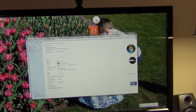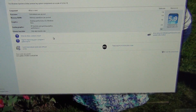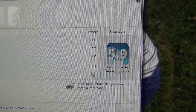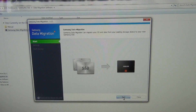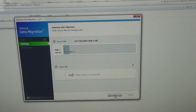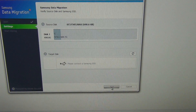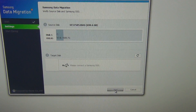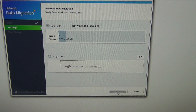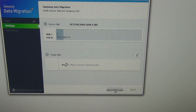The Windows Experience score is 5.9, but let's take a look at how much of that is the hard drive. As you can see: 7.4, 7.4, 7.8, 7.8, 5.9 — and that last one is the primary hard drive. One important thing to always check before you buy your SSD is to see how much space you're using. In this case there's actually over 60 gigs used, even though it only shows 57-point-something. I'd like to have more than 50 percent extra space, because it doesn't take many 10-megapixel photos to fill up hard drive space.